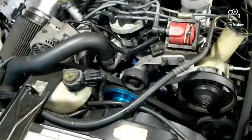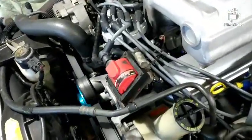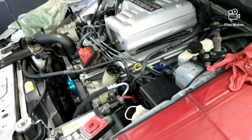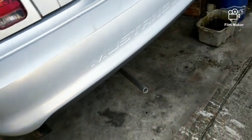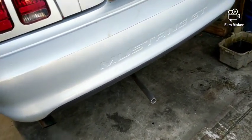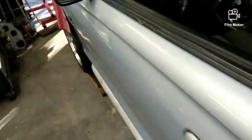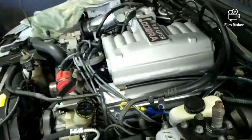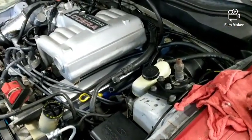Hi guys, it's running. There's a very slight noise from the rockers, but that's kind of common with them. It's idling a little bit better. I probably have to work some more on the tune — we were sucking air from the valve covers before, so it might be a little rich right now. Nothing too bad to mess with, but I think it's working out. Next step is to get the transmission swapped, then get it back off the stands and take it for a ride to see how it runs.